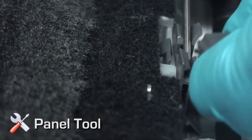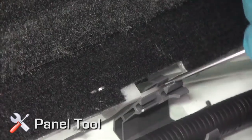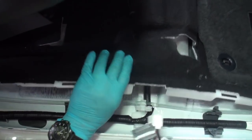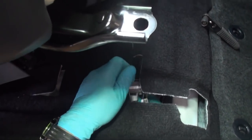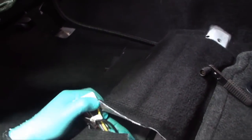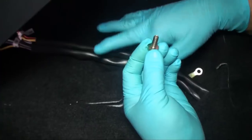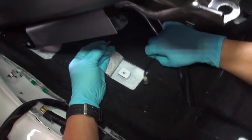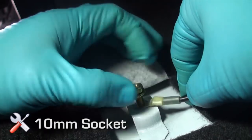You have now prepared the run for the quick sync wiring harness to connect to the amplifier, ground location, radio power wire, and sub umbilicals. Unfasten the gray and white plastic carpet clips along the threshold area and lift the carpet edge to expose the cable route. Run the quick sync wiring harness amplifier connectors and ground underneath the carpet opening from the front passenger side threshold to the passenger side opening under the seat. Locate the ground location underneath the carpet and install the harness ground with the provided 10 millimeter bolt and tighten.